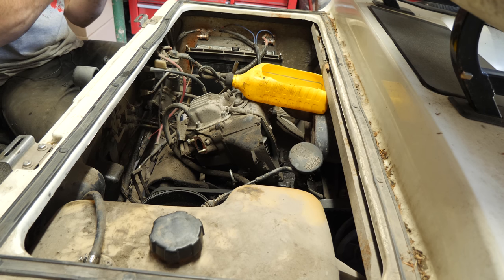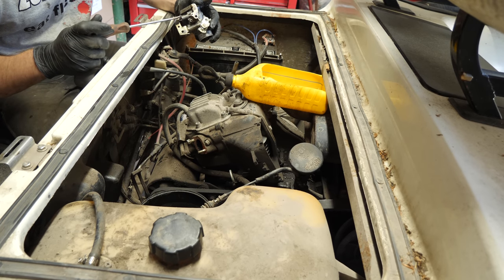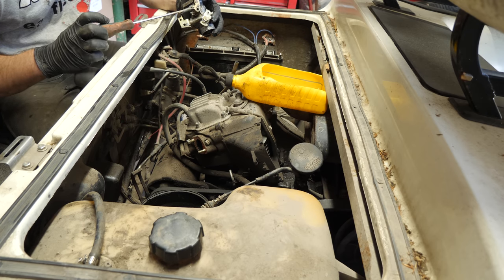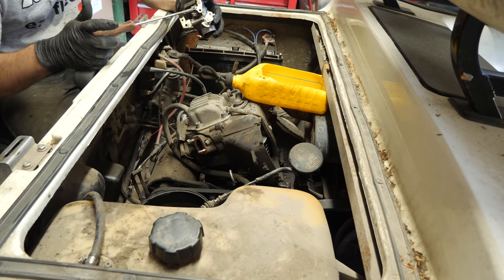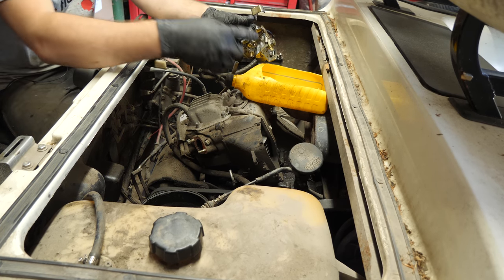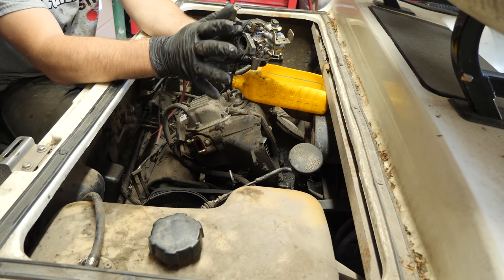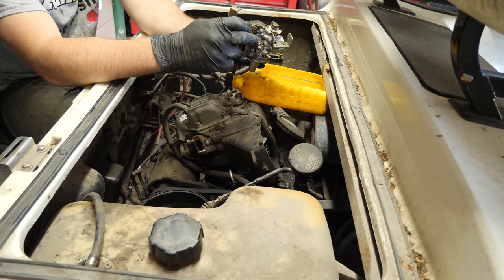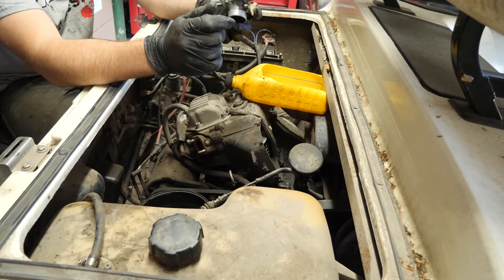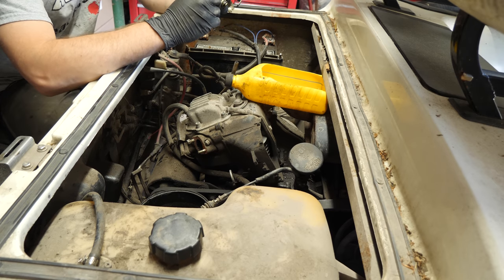It's one thing I don't work on is ATVs — I don't like working on them. So we're going to go all the way in until the spring bottoms out, and then we're going to go one and a half turns. We're going to start with that — one and a half turns out. We're going to turn this screw all the way in until the spring stops it. Don't go reefing it down until you break stuff — you just go until it stops turning easily. Then you back it out one and a half turns and go from there. We may have to bring it out to two and a half turns on some of them, but we'll try one and a half turns and see where that takes us.